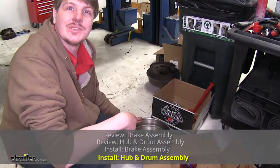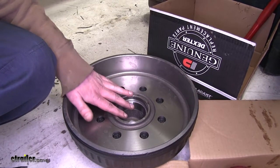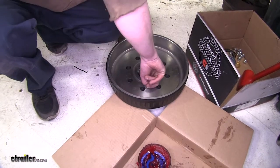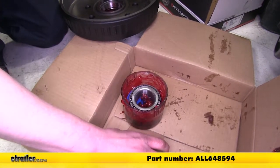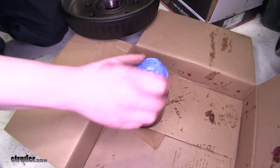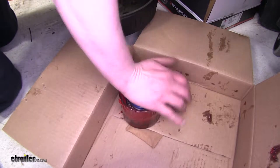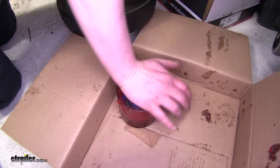We're ready to prepare our drum for installation. The bearing races come pre-installed inside the drum, so all we need to do is pack our bearings and put the seal on. Before we pack our bearings, we're going to smear some grease on the cavity inside the drum between the two races. Now we'll pack our bearings using a bearing packer, which you can pick up at eTrailer.com. Set the bearing packer with the small tapered end facing down and the larger end toward the top, put the push tool on top, and press down working it back and forth. This squishes the grease up inside the bearing so it's fully packed and we don't have to worry about any metal-on-metal contact.